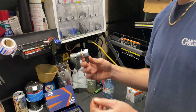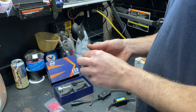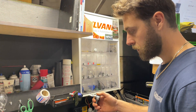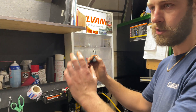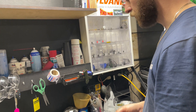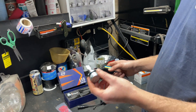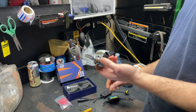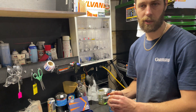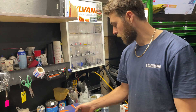What I want to tell you guys is there are different resistors that you can buy for these. A lot of vehicles nowadays, when you put LEDs in, the car knows the light is burned out and it'll set a message on your instrument cluster telling you that you have a headlight out or a turn signal out. So what you've got to do is put in one of these resistors, which changes the resistance value the computer sees and tricks it into thinking the bulb is working, since LEDs don't use as much voltage as a regular light bulb.